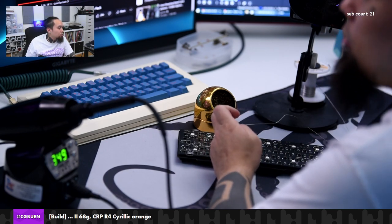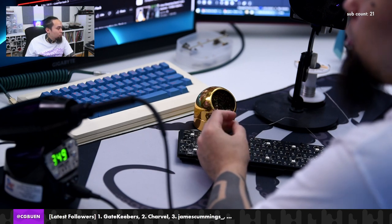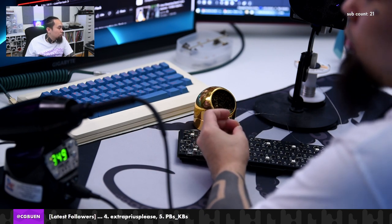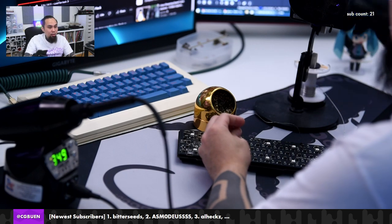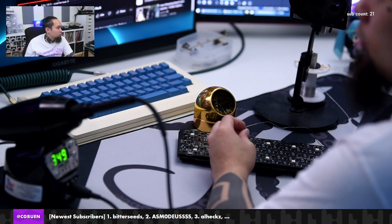So the thing is, it's 2-pin, so I think it literally has to be done through voltage, like on the motherboard BIOS. I have extra fan headers on the board, but that's the little weird part of it. But I was going through the BIOS today, and I'm like, this doesn't look that hard. I see the voltage, you could just move the slider down.